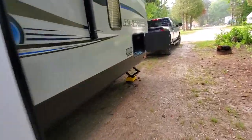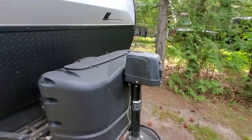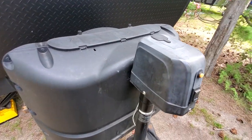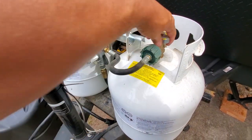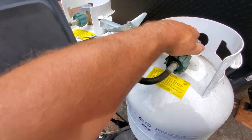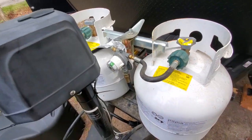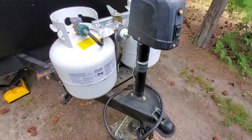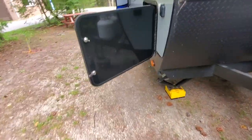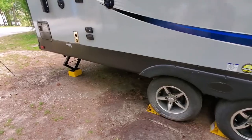Now I'm going to kill the propane — that's the next thing. I'm going to come over here to the tanks. Okay, cover's off on the propane. You can see it's green pointing to this tank, that means that one's on. I'm going to kill this and make sure that's off. This is now off — that one's dead actually, I got to remember to refill that tank. But now propane is off. So water is basically off as far as hot water goes, we got the hot water heater all set and taken care of, and double checking my switch in there is good. So we are set.